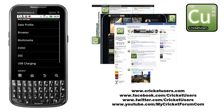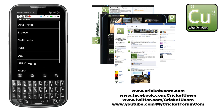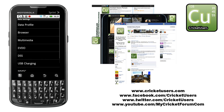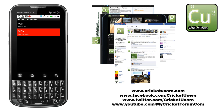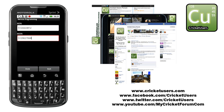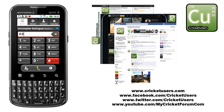You're going to want to make sure under the EVDO menu that DDTM is off. If you have an active data connection and you have DDTM enabled, you won't be able to receive phone calls. You can also access these menus directly by dialing ##DATA#. The ## and your SPC # goes into the MDN programming.